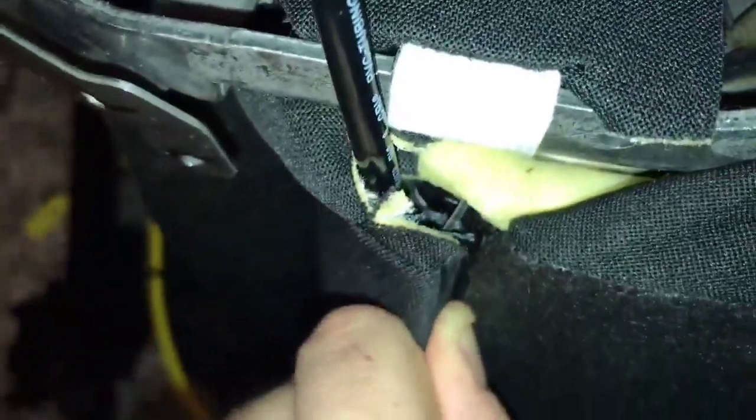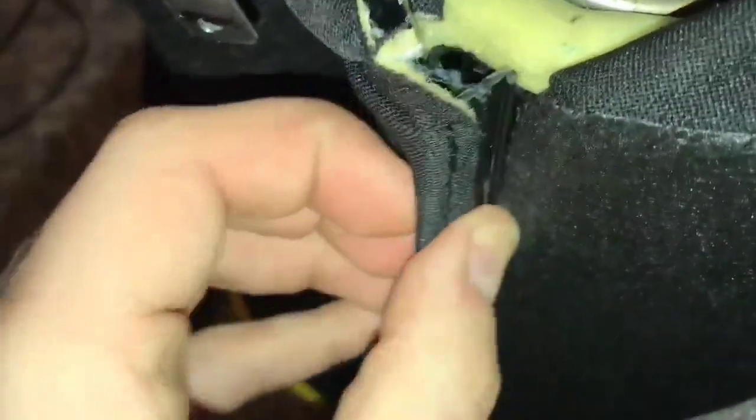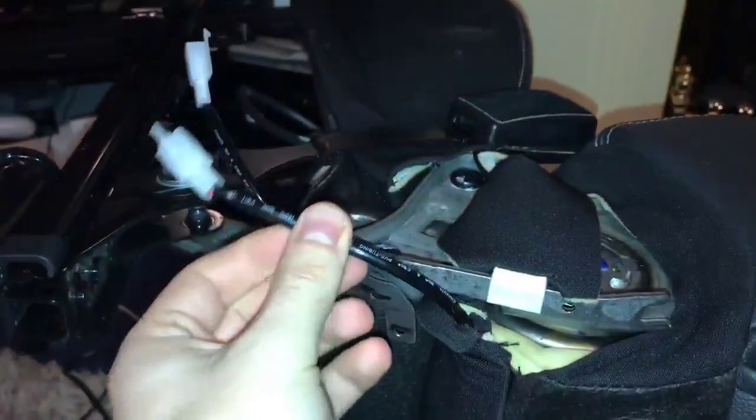You've done that last stage which is tucking the bottom lip through the gap. The heat sensor's gone, I can't even feel it. You will find your heater wire needs to come out at the same side as the seat belt buckle - that's going to be the drive tunnel. You can see these two clips which you took off to start with, which is your final step. But before that, you want to be feeding this airbag wire back through the slit and replacing it to one side. Whilst pulling the cover down, ensure you get it right to the bottom so you can feel the edge of the moulding running just on the edge of the foam. Then you're ready to do the final clip up and put the plastic trims back into place.